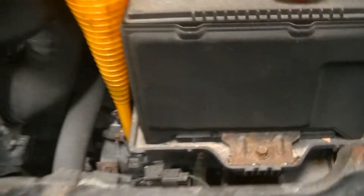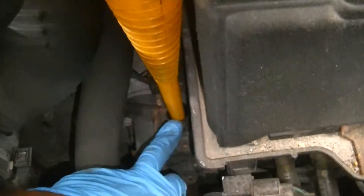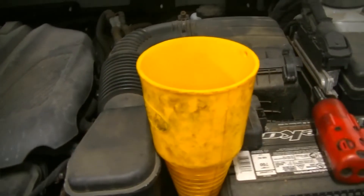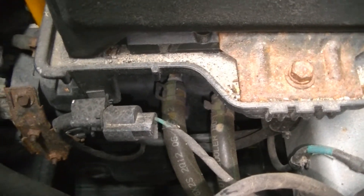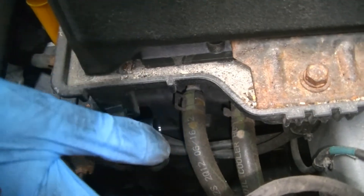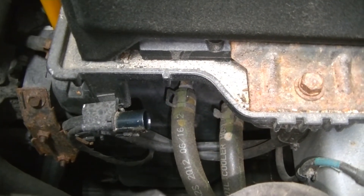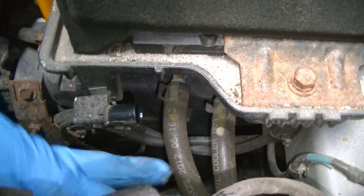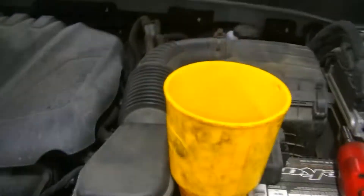Because this is a sealed transmission, the vent is built into the top, and we're bypassing that transmission vent by using this funnel. Basically, by filling this way we would airlock it — it's going to bubble up and make a mess. So to avoid that, we're going to go ahead and pull one of these transmission cooler lines. It doesn't matter which one. You can unplug this wire here — this is the positive lead to your starter to engage the solenoid. So if you do this and the car doesn't start, it's probably because you forgot to plug that back in. We're going to pull this clamp and pull this hose off, and that gets us ready for when we have to fill this back up.